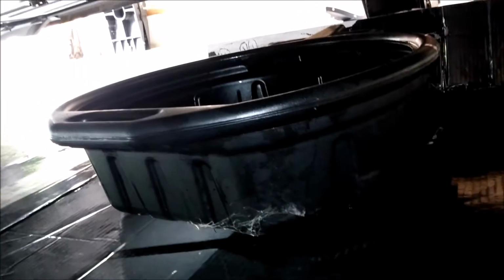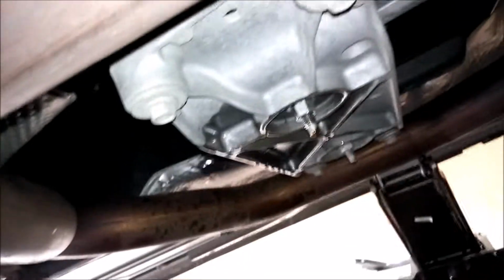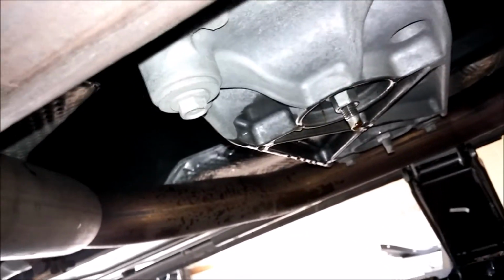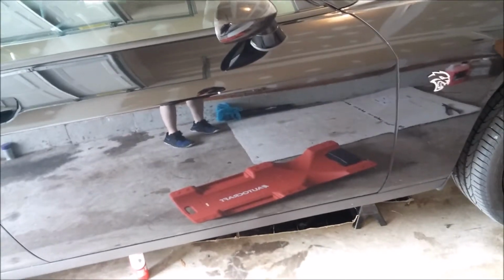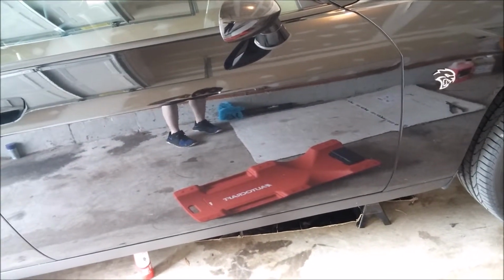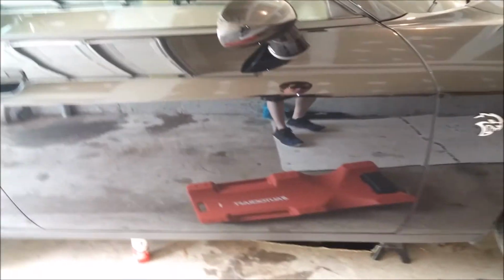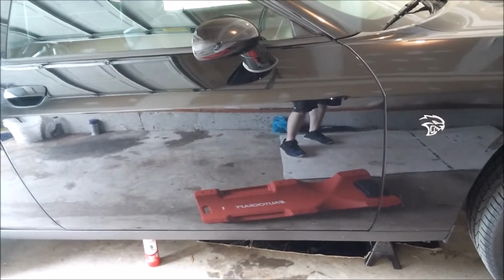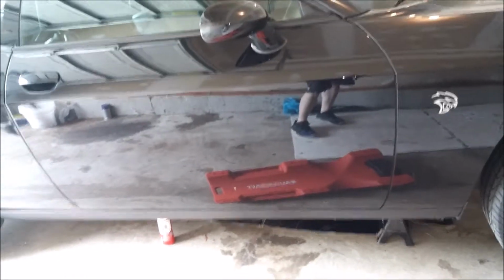All right, went to the local Aldi and got some groceries and came back, and it appears the trans is done draining. Put the drain bolt back in, and then we'll get to the pain in the ass part, which is filling. I forgot to mention, you want to hand tighten the drain bolt back in. There might be a torque spec for it, but I just make it good and tight with the 3/8 ratchet. Nice and snug, but don't put it in too tight and mess up the head or make it hard to get out next time.